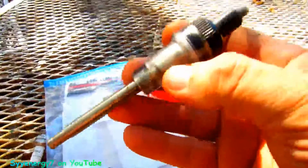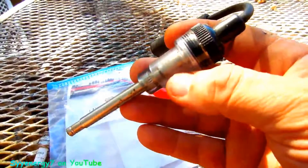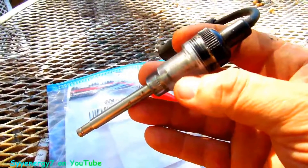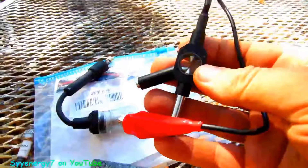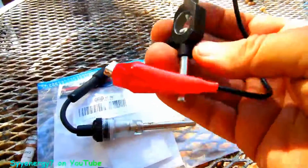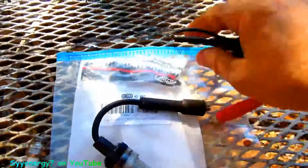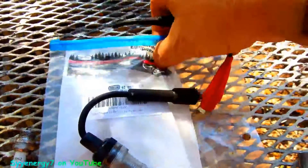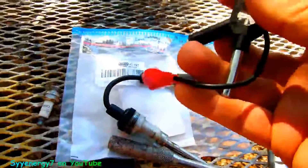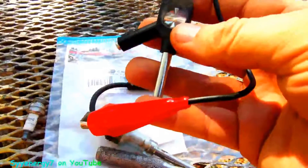This is your typical spark tester. These check for spark versus no spark, but generally check to see if you got an adequate spark. There are other adjustable spark testers out there that can cost about sixty or seventy dollars or even more plus shipping. This one is from Oregon Power Equipment — the guys that make the chains. It's model 42-87, and it's like even ten bucks, that's what I paid for it. You can see the gap there in the glass.